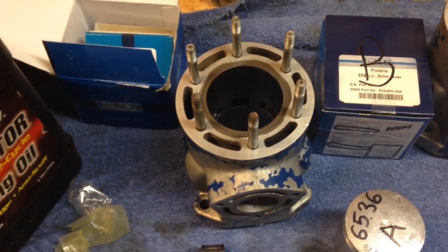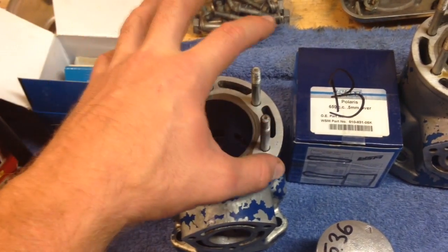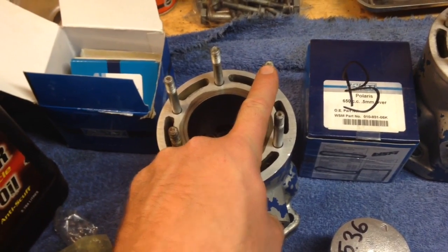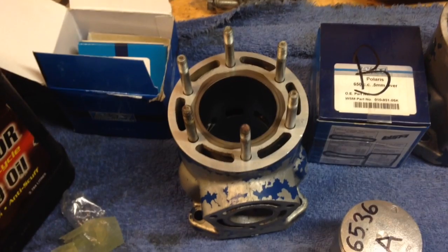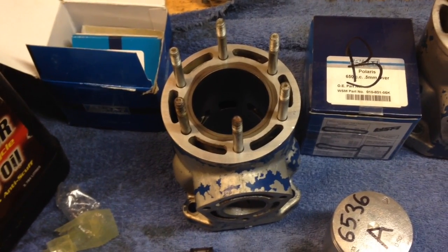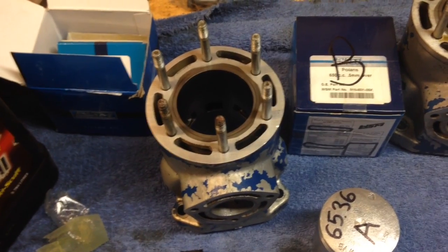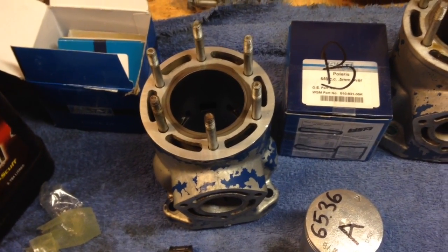After that's done, then you're going to put on the head gasket, which goes over the whole thing, and then put on your head, goes over that, and then you're going to do a lug nut pattern, which is like a star pattern for that, so like this. And the torque spec for that is 18 foot-pounds. After you get that all together, you're good to put the spark plug back on and finish assembling the intake side of things and the exhaust.